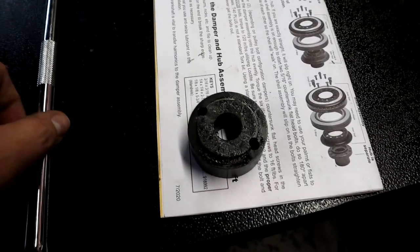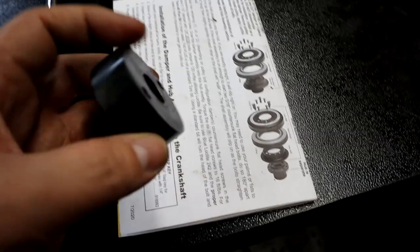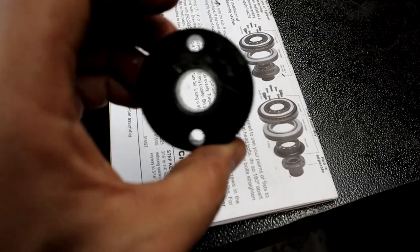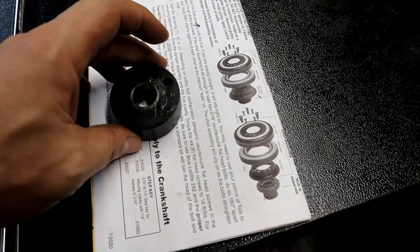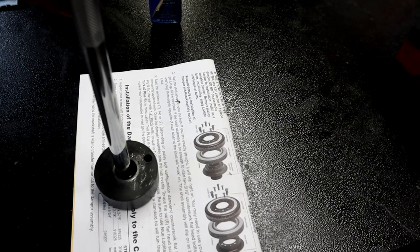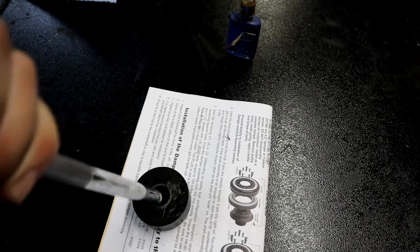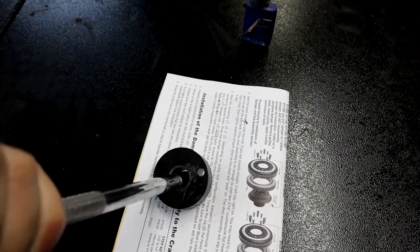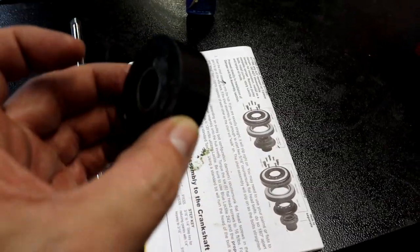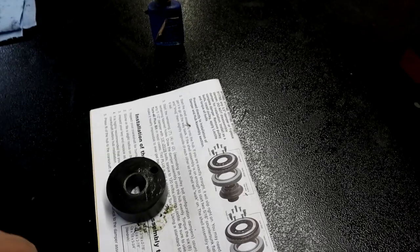All right, guys, so we got our crankshaft drilled. I'm gonna show you what our holes look like here in just a second. And sometimes getting this tool back out after you remove the bolt and do the drilling can be a pain in the ass. So how I get it out, and it's worked for me, is I get a long extension, and while this is still in the crankshaft, I'll put this in here, I'll pry down on the extension at a hard angle and just kind of waller it and pry it around, and eventually it pops out and falls out and comes right out for me. So if you get one that gets stuck, that's kind of what I do. If you get an extension and just kind of waller it around, it'll pop out for you.